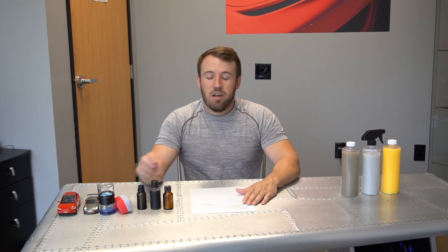Is it like a ceramic coating? Short answer is yes. It's a semi-permanent coating that bonds to your finish and protects against oxidation, UV rays, water spotting, light scratching, and light marring. One important point: this coating is not scratch-proof. It still can scratch — you can't take your keys or a screwdriver to it without seeing scratches, or wash it with mud and not get swirl marks. But it gives you the most resistance possible compared to a normal sealant or wax, with additional benefits from the graphene infusion.